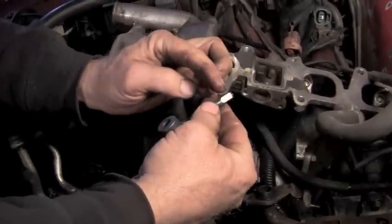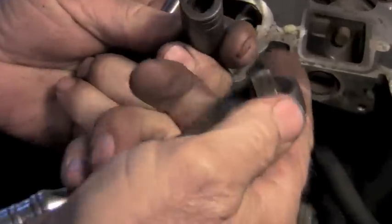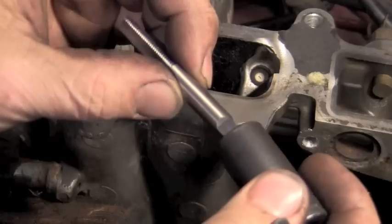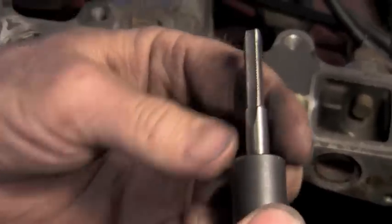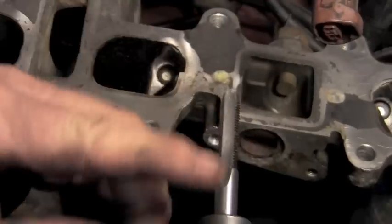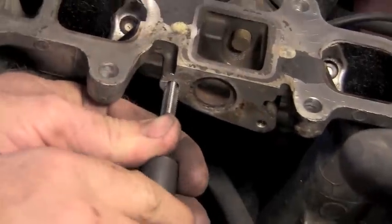This tap comes with a square shouldered shank on it. They make sockets that'll fit your 3/8 drive on this end, depending on which size the application is. It slides up in here and it locks in, and it is used to turn that square shank. So this is the tap that is a specific Heli coil tap we're going to run up in that 1/4 inch drilled hole.